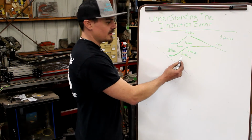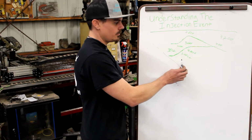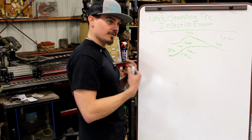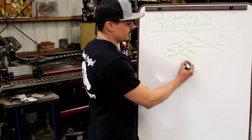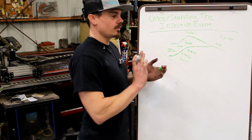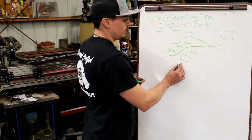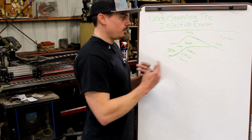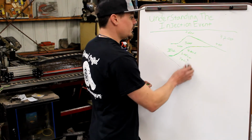But let's say that we're cruising at 2,000 RPMs at 70 miles an hour, 60 miles an hour if we got 410s. You may only be using 70 cc's. And this we can go back to where we're talking about the spill ports getting opened earlier based on where the plunger has been rotated inside of the barrel. So we only need to put in this many cc's. But if I were to floor it and I had full rack available, so my AFC foot was all the way forward, I can floor it instantly to 200 cc's.